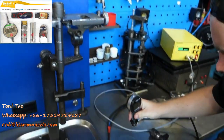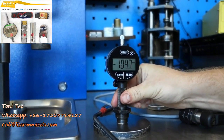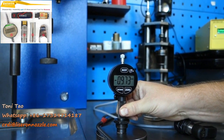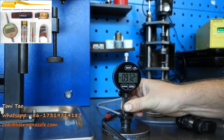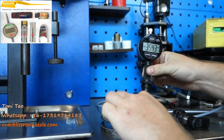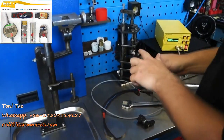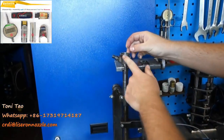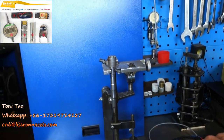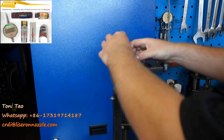We move over. As you can see, you can use the adapter to also measure your shims. This shim is slightly bigger — about 40 to 45 microns higher. It's fine. The Digimaster will still be able to tell you whether it is correct or not. Make sure that the casing is dry before placing in your shim. If the casing isn't dry, the readings won't be correct.